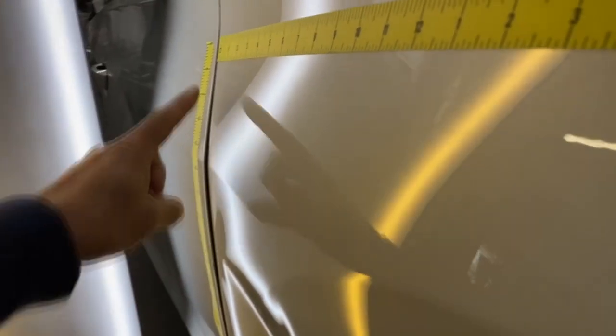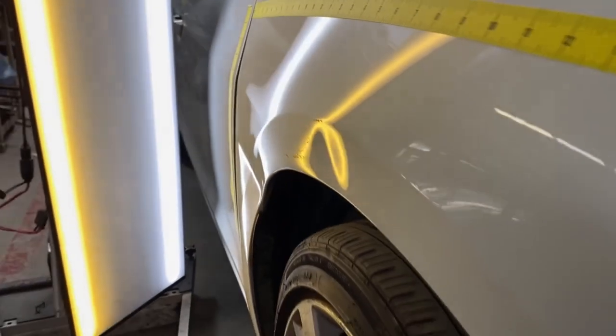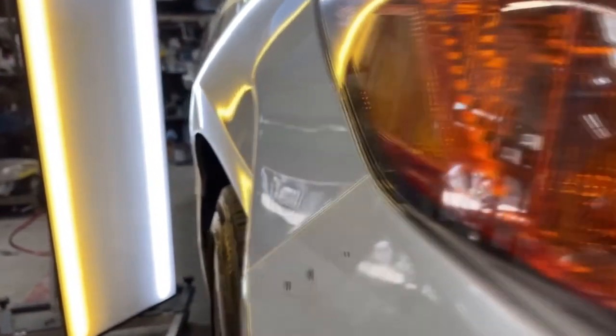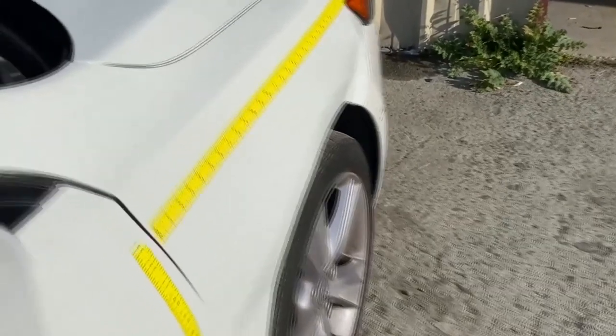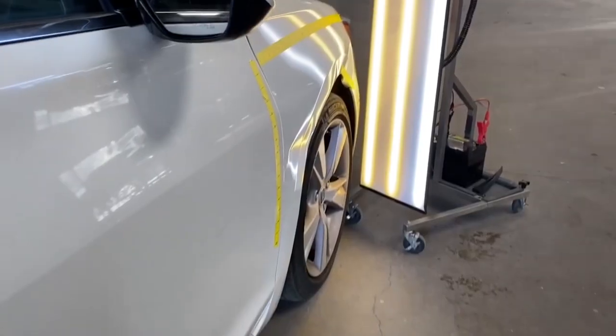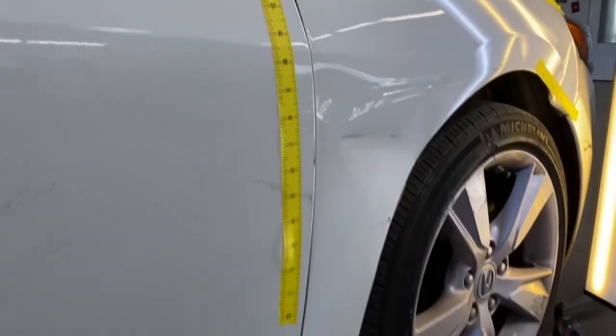Here is another angle with the light. The edge will need to be lined up — not a problem, I've done a few of these. Backing up the camera, you can see how deep that dent is. Here is under natural lighting — you can see the front nose of that fender edge. Pretty deep. The entire fender buckles up underneath and rolls inward. Here is with my 4-foot dent light — it's a 4 by 12 — and you can see the good rolling effect there. The entire edge needs to be restored.